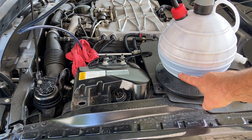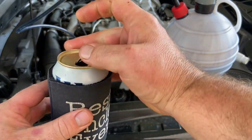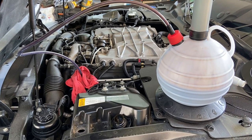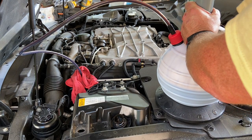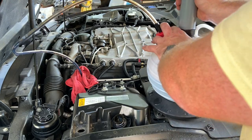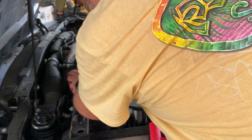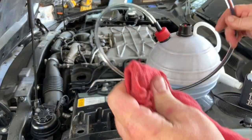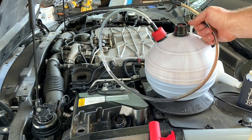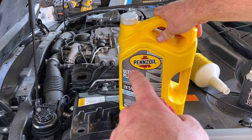Up to about two, three — three and a half roughly. So got about another quart to go. There she goes — you hear the magic happen, tries to get those last bits out. So there's no vacuum on here now, let's pop it loose again. Watch out because you're going to have some dribbling pulling out. There's the rest of it. Now I've only got one extra jug over there, so we're gonna add in a quart of oil and dump this so we can figure out the total amount we extracted. All right, so we're looking at 8.15 quarts of Pennzoil Ultra Platinum 5W20.